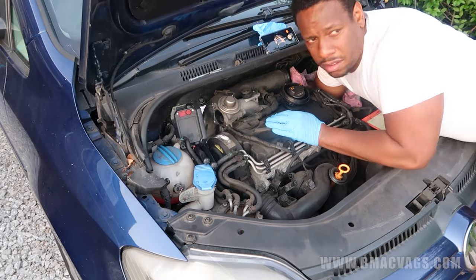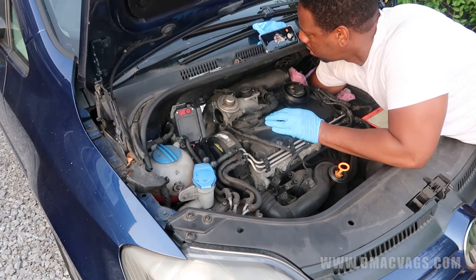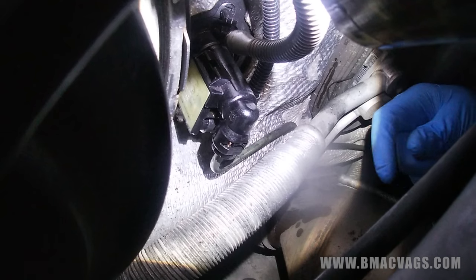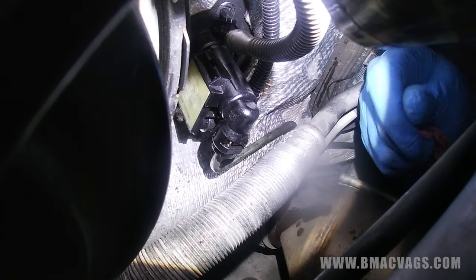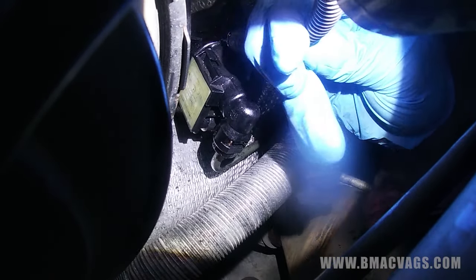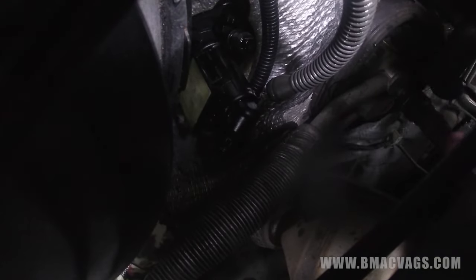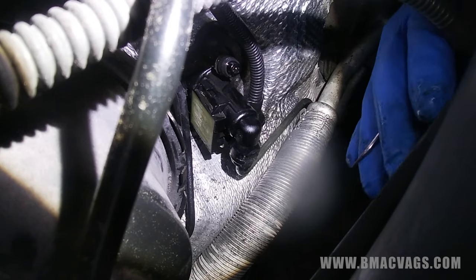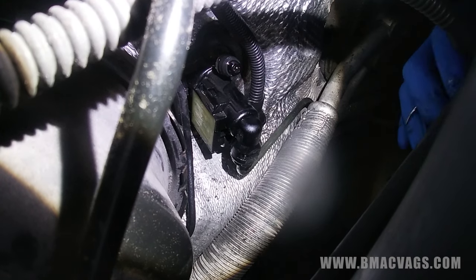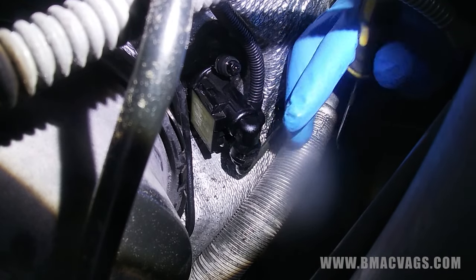Because it was so tight in there and scratching my arm, I wrapped a pillowcase around my arm just to get some access around the back. Here's the master cylinder up against the bulkhead - some people call it the firewall. The first thing you've got to do is remove the feeder hose from the top - that just pulls off. Remember that brake fluid is quite caustic so make sure you clean it up wherever it goes.